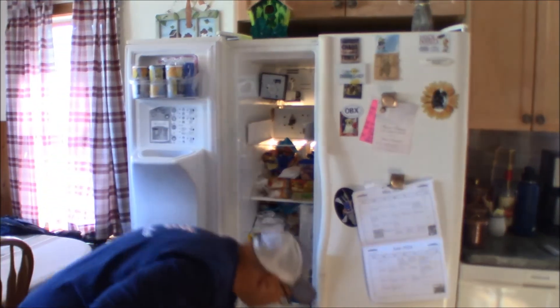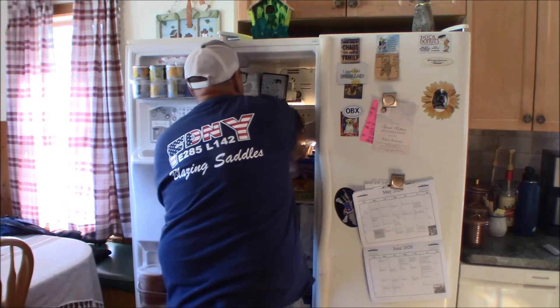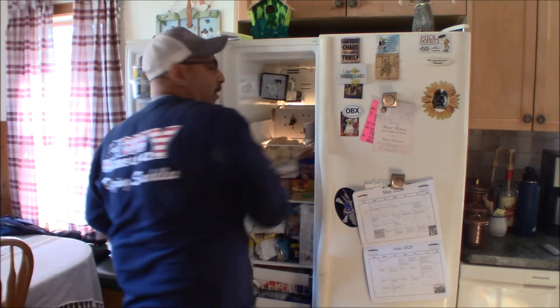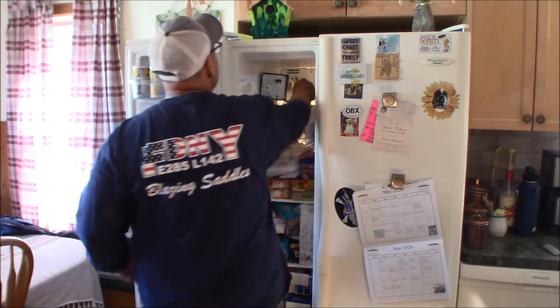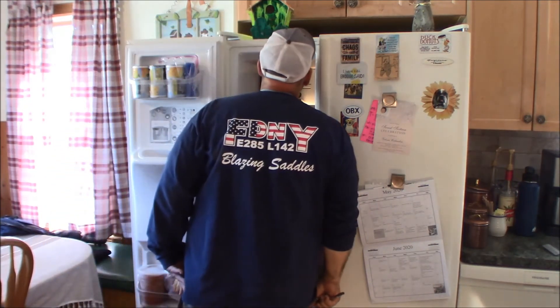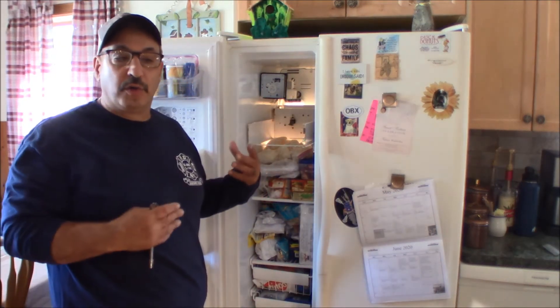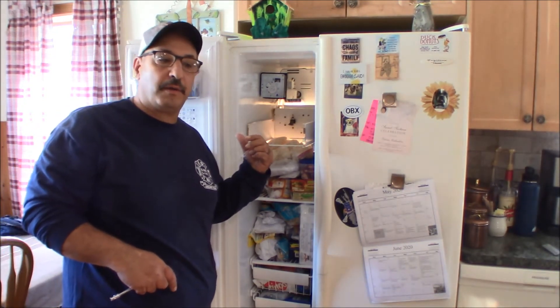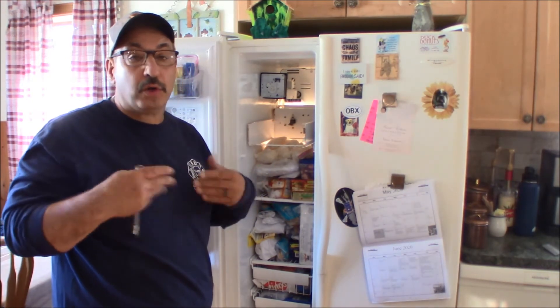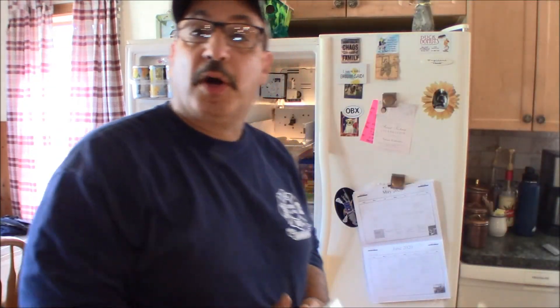All right, I just hung it on those two sheet-metal screws and got some of my wife's frozen cauliflower out of the freezer. I tightened the screws up, that's off and that's on. I don't know if the refrigerator knows there's a new one in or not — I don't hear the water running. I'm hoping the water flow isn't our issue. There is a solenoid valve for the water feeding into the ice machine, so we're hoping that's not an issue, because then putting this part in would have been a waste of time.